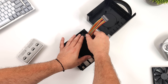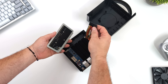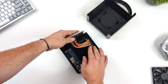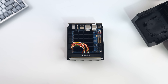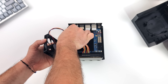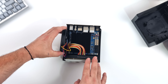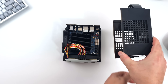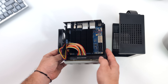Now we'll get this secure with four screws, then grab that GPIO cable — plug one half into the board. They do have full instructions on their website. The front IO panel also needs to be plugged into the other end. I'm really glad we have that power button externally; it's not one you have to screw in or anything like that — everything works over GPIO. Last thing is to install the fan because I don't want this thing thermal throttling. Even though it's a low wattage chip with that Intel N97, in an enclosed case we could hit thermal throttle even with that large heatsink. A little fan blowing air across the unit will work great, and we've got plenty of ventilation on each side of the shell.